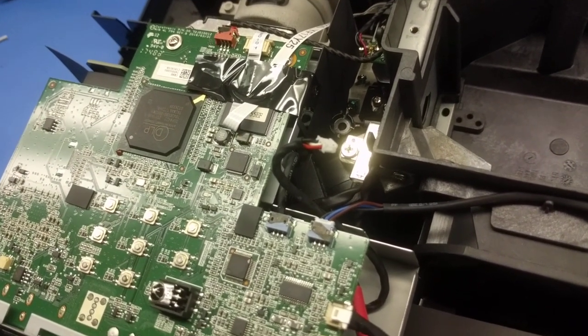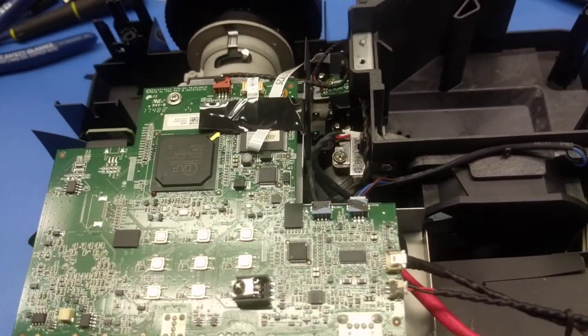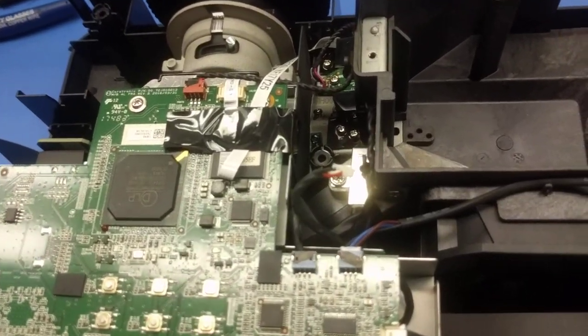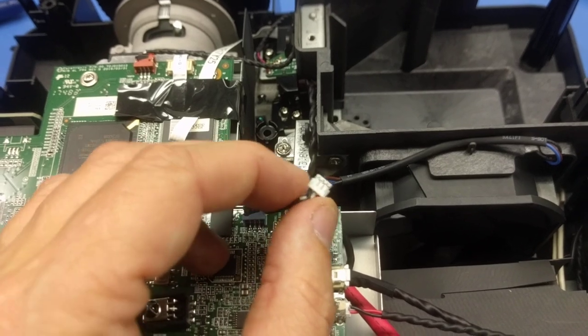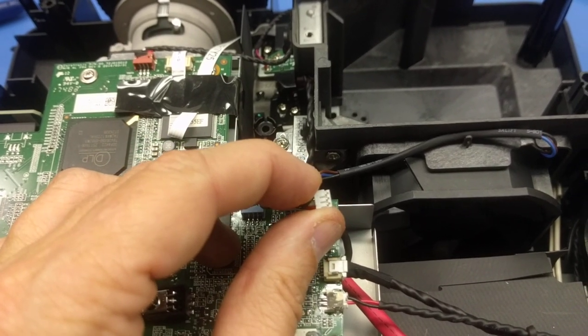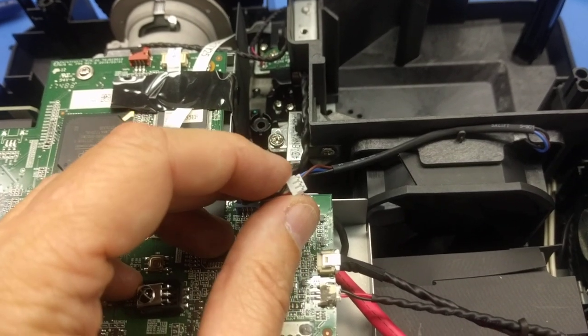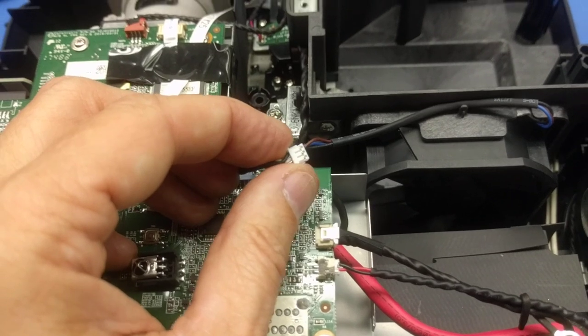Now, as far as the repair of it, a competent repair person or engineer should be able to take care of this fairly well. They won't be able to change the contact size, but these JST-style connectors, if you have experience working with them, have little tabs that you can extract the contact, make sure you have a good crimp inside the contact. Usually you do this under a microscope.